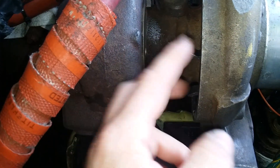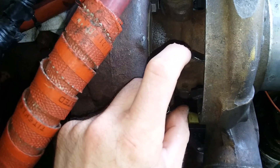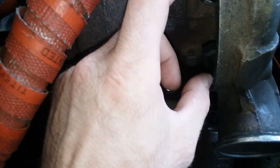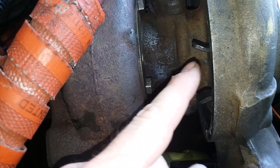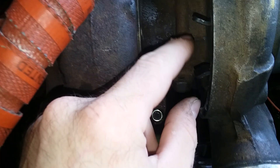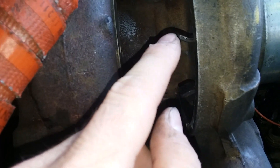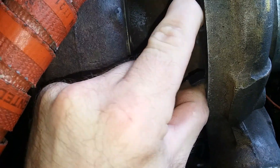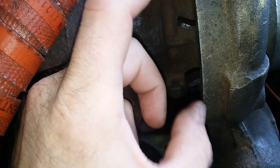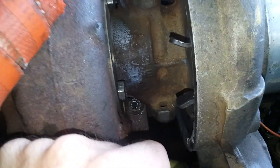This spring clip tends to back out pretty easily once it's pushed down. My advice is go ahead and push it down, pull it out, rotate it, and get it where you want. Mine were bent way further down, so my channel locks kept slipping off. What I did was I heated mine up with a little mini torch and bent them back, so now when I put my vice grips on there they don't slip off - a lot nicer. I spent several hours trying to get it off before I heated it up, so just a tip.